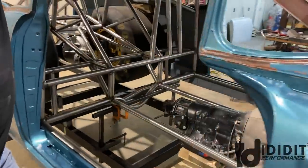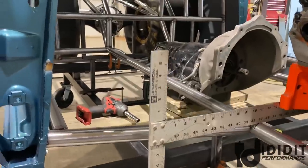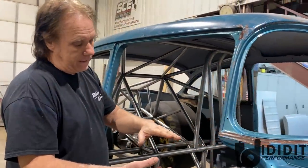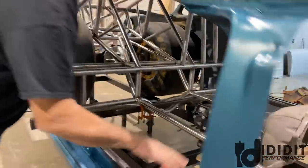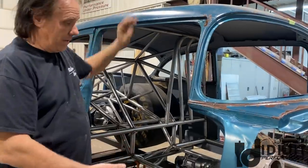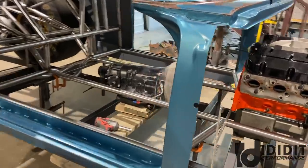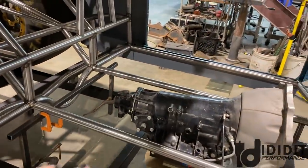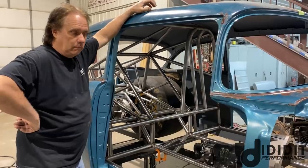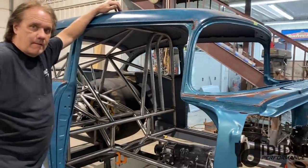That's some progress. That's nice because now you can see how the floor is going to literally be flat, but raised up 2 inches. At the same time, there's 4 5/8 or something like that inches underneath the tubes to the bottom of the rocker panels. So the car's way up off the ground. If you ever decide to turn it into a grocery getter, you've got lots of room under there for exhaust, mufflers, speed bumps. You could literally hang giant mufflers under there and not even see them. So you can kind of see the basic shape. Then there'll be bracing in here, which you'll be seeing soon. And hopefully soon there should be some struts delivering, we ordered them from Summit, so that way you can move forward at a continuous pace.